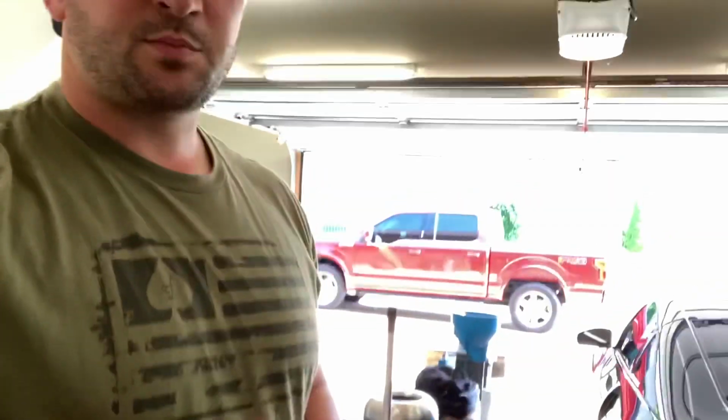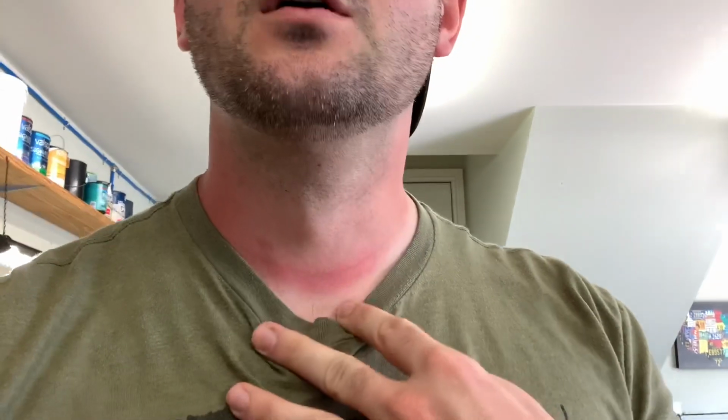Fuel will be good. The next part we've been talking about is turbo selection. I've gone back and forth from the GTX3582R, which I think is a direct replacement for the turbo that originally came on the kit. Then I talked to a couple other buddies about the GTX3584RS, which was pretty solid. But then I talked to some guys at ZCon who let me know about the new straight G series turbo. So I'm looking at the G35-900 turbo, which is pretty expensive, but it's got all the newest technology, supposed to have really good spool time, and should be a direct bolt-in. I'm thinking I'm going to go that route. I'm not sure. If you think I should do something else, let me know. Man, my sunburn's bad. Ooh, terrible. I think that's going to do it though.